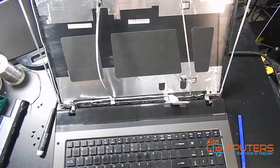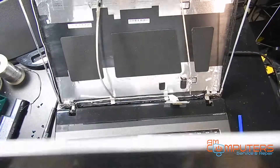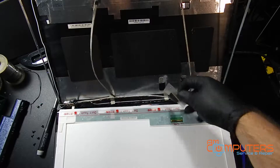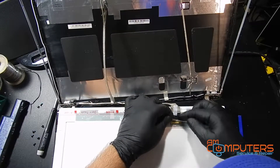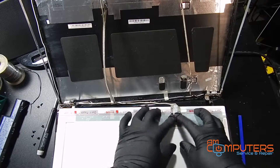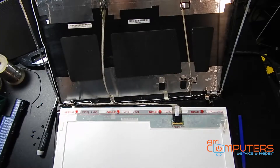So there it is — busted screen. Now we have the replacement screen. I'm just going to flip this over and then gently plug this connector back in. Re-tape around it and firmly press down. This looks like it's got a good connection. Sometimes I add more tape if it feels like it might come loose, just to give it a little bit more stability. But this actually had a lot of tape to begin with, so I feel pretty confident that's going to be nice.